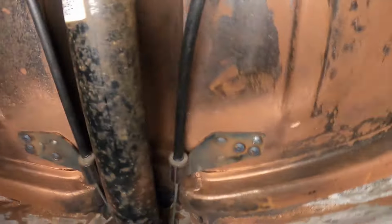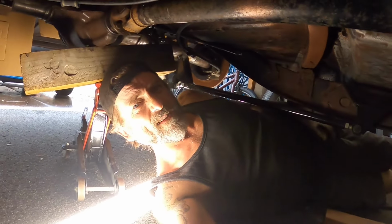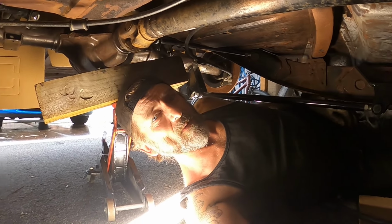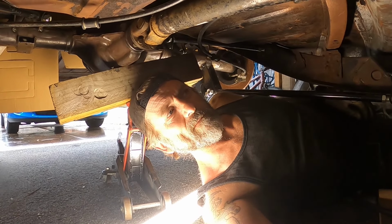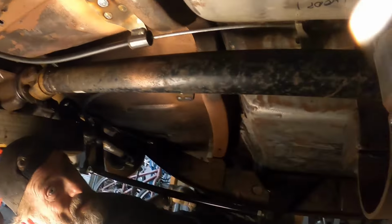Okay, so that's them all plugged in there. The copper weld through primer definitely seems to help. Plus I've whacked up the wire speed a little bit to stop it dropping back down and landing on me. On the whole, those little plug welds went right well, as long as they penetrated up the other side, which I'll go and have a look at now, to make sure.